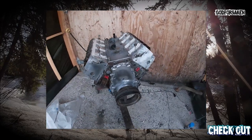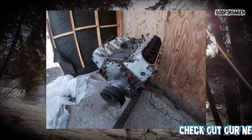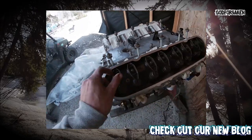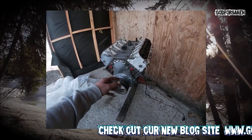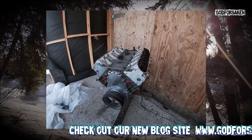Still a lot of polishing to do, still a lot of work to do. We'll pull the rocker arms next, pull the push rods out, and then think about pulling the heads. Then we'll get the block painted — we should pull the harmonic balancer, get all the covers off of it, and start from there.